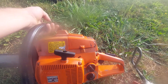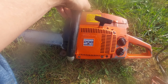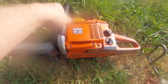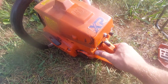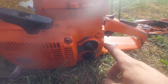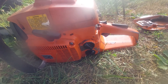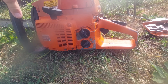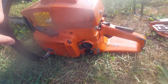For those of you that don't know what a 298 XP is — it's pretty much the exact same saw as the 2100 or 2101 XP with some minor differences. The 2101 and 2100 both had a manual oiler back here with a plunger that went in between the seam between the gas tank and the oil tank. The common problem with most 2100s and 2101s is the oiler leaks oil into the gas tank or gas into the oil tank — they've got little O-rings that tend not to seal well.